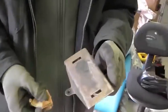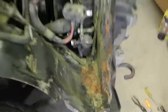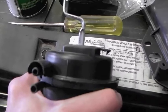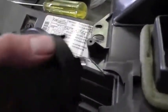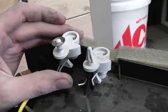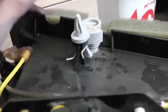Remember we had to disconnect the air conditioner and remove the fender to get to this bastard. This cranky bit has to come off the end — it's got a little tab in that hole. You can just get that with a flathead screwdriver from above and then pull. Here we see old and dickered versus new, designed exactly the same way. I've got the first three openings filled up with JB Weld and a piece of masking tape over it to contain it while it cures — hopefully that'll be a little more durable. If you're replacing these actuators, there's a little clip you have to get off. It's a little easy to install — just needs two hands.